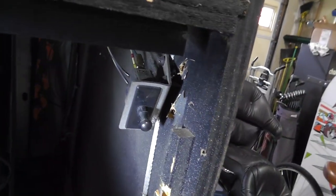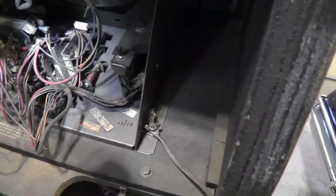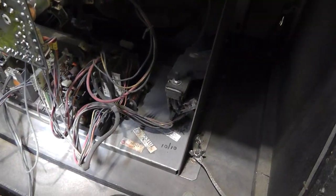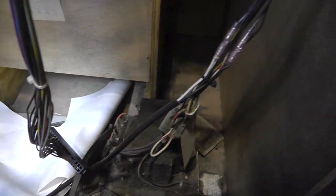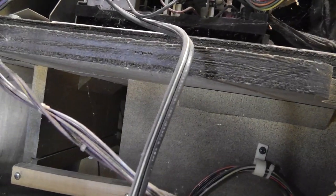Got the back door off. Looks like a little bit of work needs to happen on the interlock switch. It's a Wells Gardner 4600 monitor — serial number area shows five-three-zero-three-five-nine. There's the neckboard, so this does look like an original 4600. The power supply is not original — it was modified, because it normally came with a Defender-style power supply. There are some papers and a lot of dust and cobwebs to clean out, but absolutely no water damage.